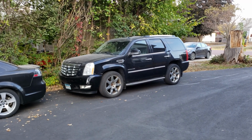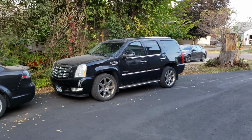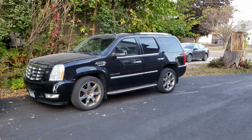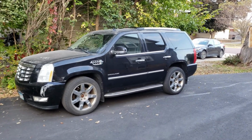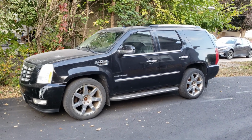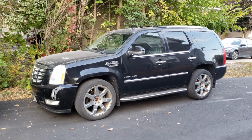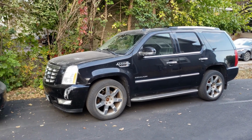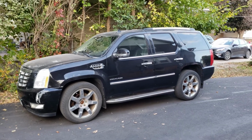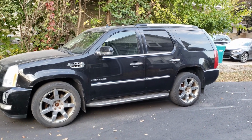The issue I was having was a P0172 and a P0175. Fuel system too rich for both Bank 1 and Bank 2. That's both those codes. And if you've got a GM vehicle and your remote start doesn't work, a lot of times it's because your check engine light's on. Sometimes because your hood's open or some other feature. So like the remote start won't work on this if like the rear hatch is loose or ajar.